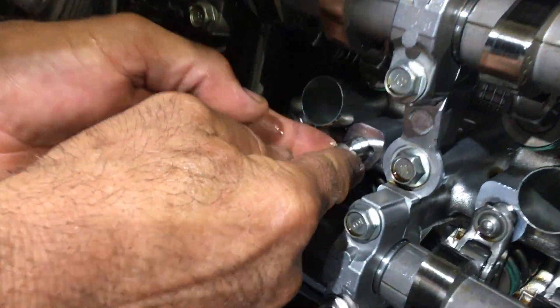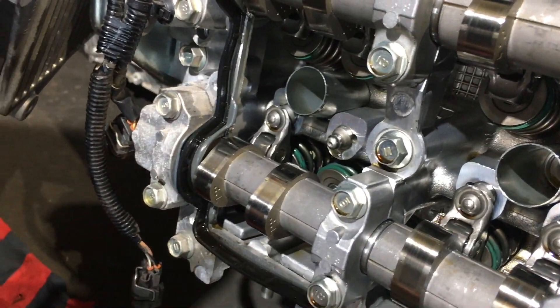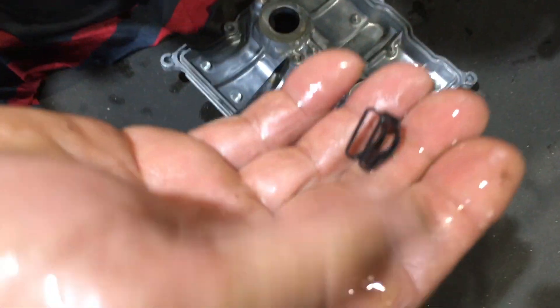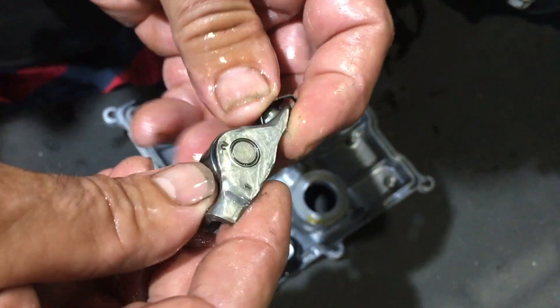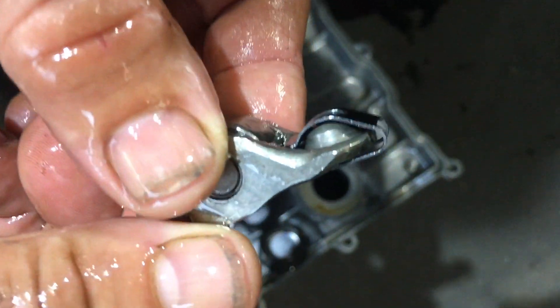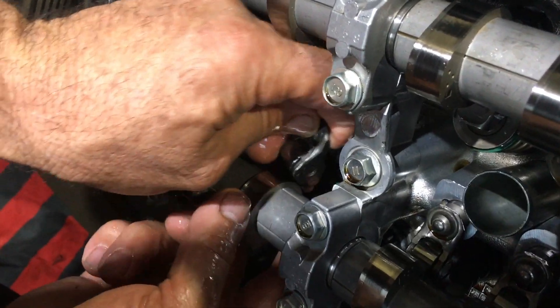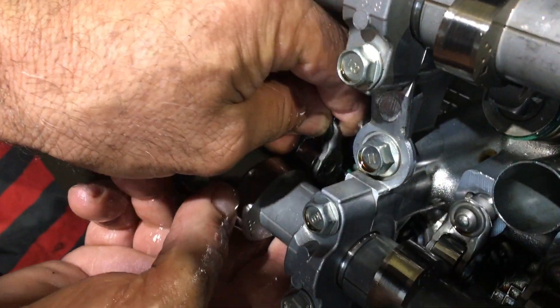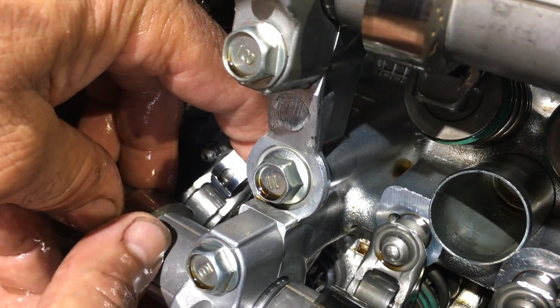I've soaked them just to get some lubrication on them. We'll place that in its spot — it's a lot easier to see on the exhaust cam doing this; the inlets are a little bit more difficult but not so hard. This is the tricky bit — this is the rocker clip. You put that onto the actual end of the rocker where it pivots, not the valve stem side, obviously the pivot end. That's the rocker retainer clip — we've developed these to use on only this engine. You've got to feed this bit onto the rocker onto the valve stem, making sure that the little lash adjuster bucket is not dislodged off the valve stem.